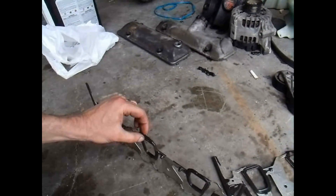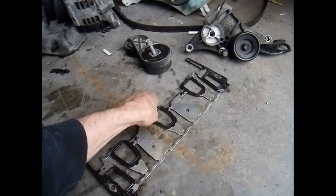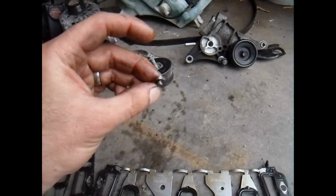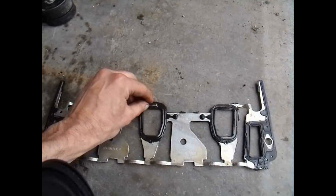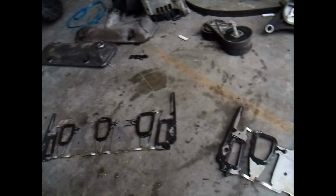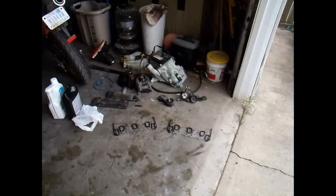What happens is they didn't compress as much as they should have. The problem was a little metal tab inside these gaskets that won't compress — this is what sits inside the head right here. Whenever I torqued those down, that metal tab obviously will not compress. If you're having a strange misfire and you've had to do an intake manifold gasket — especially if your car has over 100,000 miles, though sometimes it doesn't even take that long — this could be your issue.